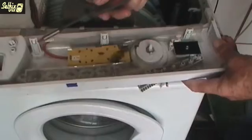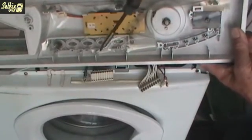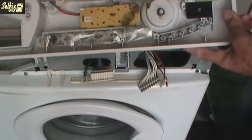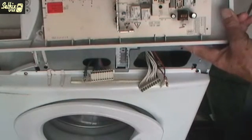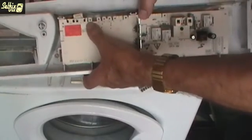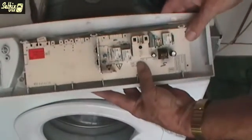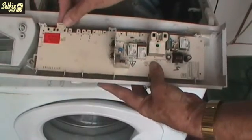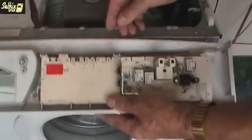These three clips hold the module in place, while the upper section hooks into these bits of moulding. Be careful how you hold the module while you fit the upper section into the fascia. Then press down on the lower part at each point by the three pillars and it will clip into place. At this point you may want to refer to your previously taken photos or diagrams as to where each edge connector fits.